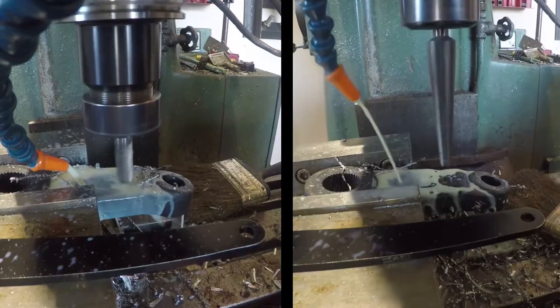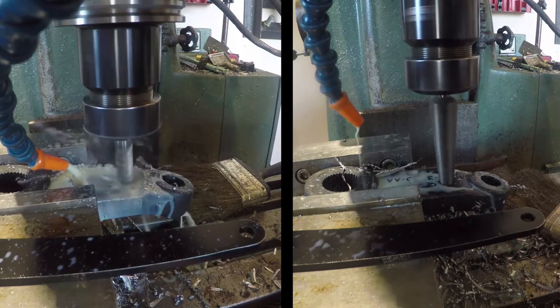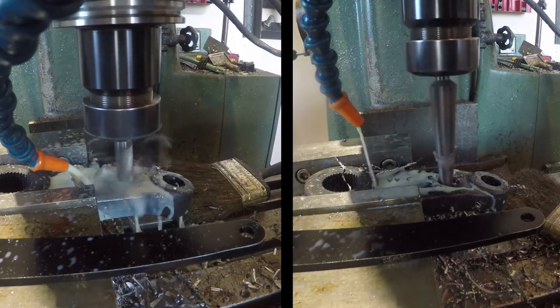During this process, I had an idea. If I make the Pitman arm shorter, I can also make the upper half of the Swing Link arm shorter. This would give me some much needed room in this area. I drill and ream a new hole for the drag link to mount to, which will effectively shorten my Pitman arm. Except I'm wrong — I later find out that this new Pitman arm length is much too short. My wheels can't turn as sharply as I would have liked, so I buy a new Pitman arm and throw this one in the trash.